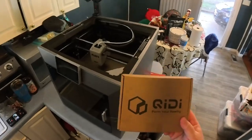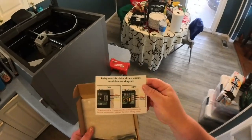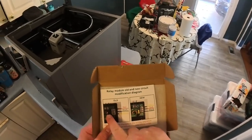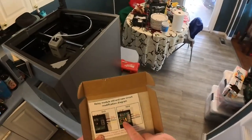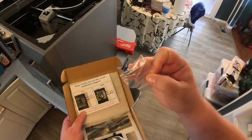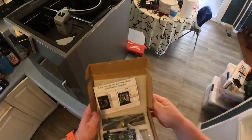Just in case I'm ever doing something out of the house and something happens. They graciously and very quickly expedited me this kit to repair it from China — took about three days via DHL delivery. In the kit you get your wiring diagram to show you how the old one went in versus the new relay, and also the difference: the old one has very thin wiring which wasn't handling the amperage properly, whereas the new one has the appropriate gauge copper to handle the higher amperage on 120 volt. You also get a couple screwdrivers, hex drivers, an allen key, four screws, the relay itself, and a cover for the relay.